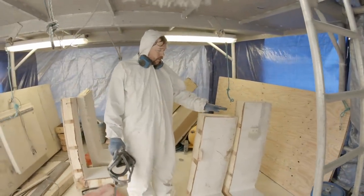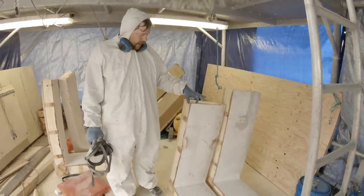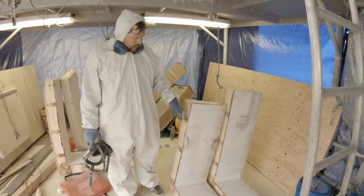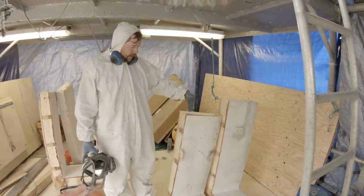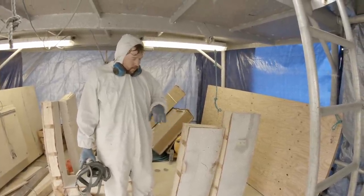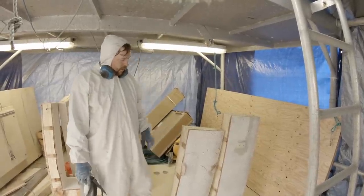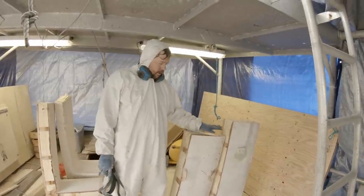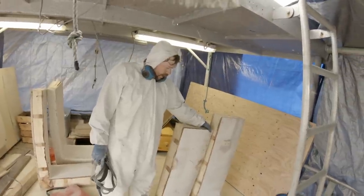So I think we're just gonna reuse these. We'll trim the inside of these about an inch and a half, cut the 2x4, put a new sill plate, if you will, in there, and then we'll fill this back in with the overlap with the beam underneath, because we're gonna have a beam coming down anyways. So I think that's gonna work out pretty good. We can just recycle these anyways. Probably makes a lot more sense.